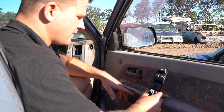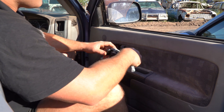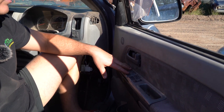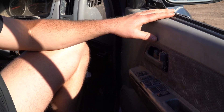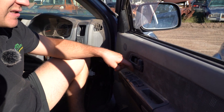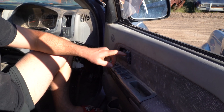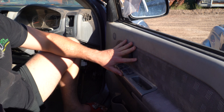This is the part we are taking out of the door, and this is the one you're putting back in. You're here because you're having problems with your window. If your window busts out on your master control switch, that means you can't put your window up and down. The problem is you don't know if it's your switch or the regulator. The best way is to buy the switch because it's the cheaper of the two. Put the switch in — if it fixes your problem, it was the switch; if it doesn't, it's your window reg.